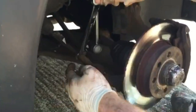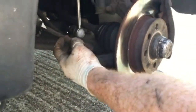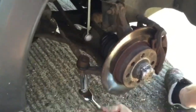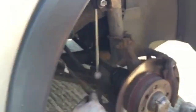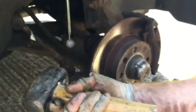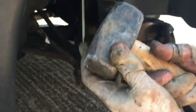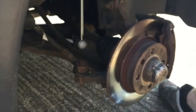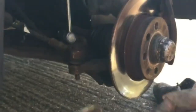...and that's half a turn. Now this nut has been released half a turn. Use a 17 ratchet — anti-clockwise is undoing — to release it, and then undo the nut until the nut comes off. Once you have the nut off, get a hammer and knock it a little bit to the right, to the left, a bit harder than that, and then really hard. It might be quite a hard job to get this out, but just a bit of elbow grease and eventually it'll come out.